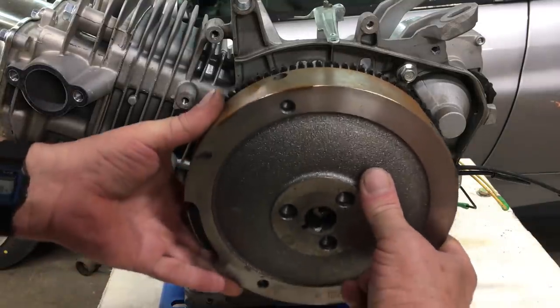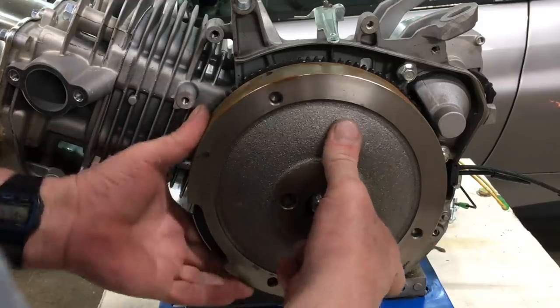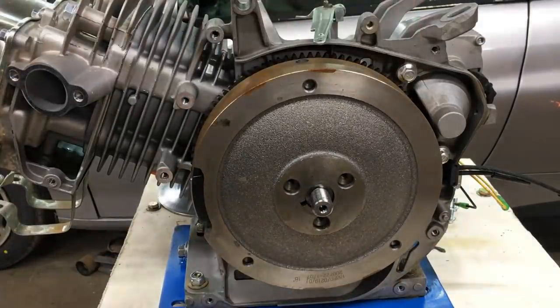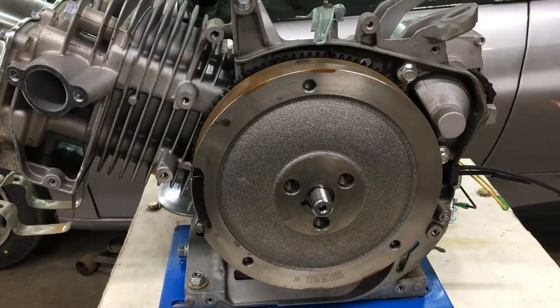It's kind of ironic — this car started life in 2001 with a 144-volt battery and had enough electricity to power a small house. Now we'll be lucky if we can generate enough power to run the engine and a few accessories. We do have a plan B if necessary. The rectifier and regulator we'll eventually use is from a Kubota tractor, but that's a project for another day.